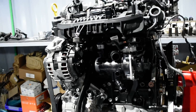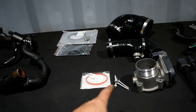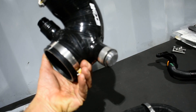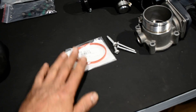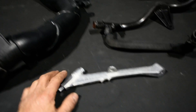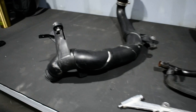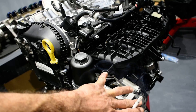The oil lines are waiting there for the oil cooler. The crankshaft seal is done. Turbo mounted. Vacuum pump on. What else: coils, the throttle — after routing the wiring. These are the charge pipes. This is for the air filter — the new pipe. Crankshaft rear seal, throttle seal, hoses with small clamps on the charge pipe, MAP sensor. The bracket for the engine mount, the bracket for the intake manifold. Charge pipe for the intercooler — going mounted on the intake manifold, one bolt here, one bolt there.